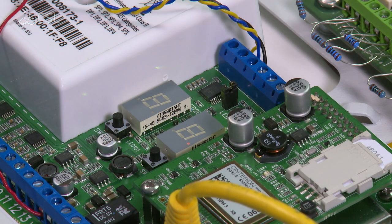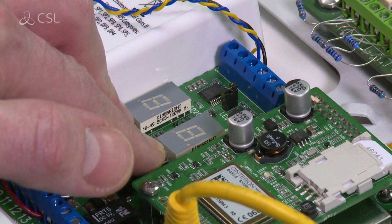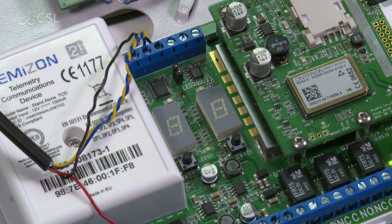To apply the latest firmware, press and hold the mode and set buttons together for 10 seconds. This will establish a connection to the Amazon server. The display will flash UF, then UC, and reboot to T1, then 01.